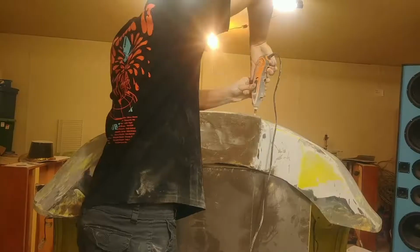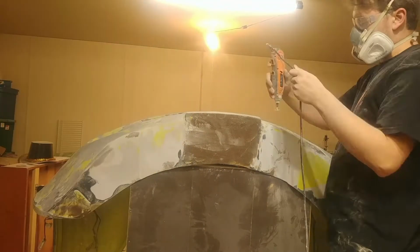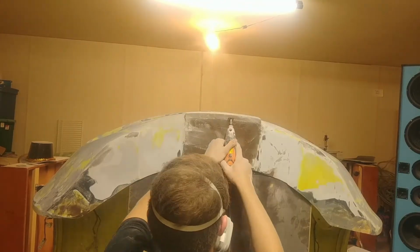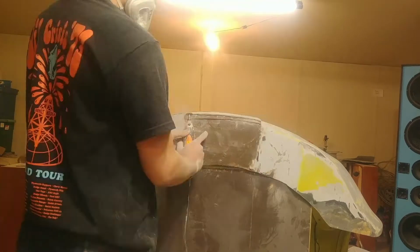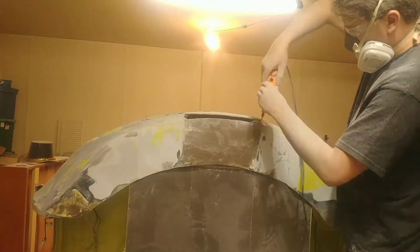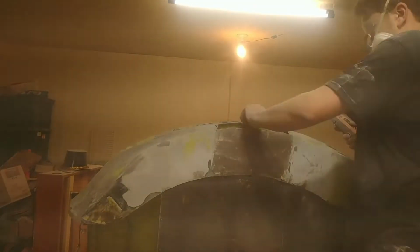I came to a realization about the front license plate holder that protrudes out. It would be just as difficult to fix it as it would be to remove it altogether, so I ended up doing the option which looked better in my opinion. This required cutting out the box, taking the front face of it and fiberglassing it back in, making it flush to the body.